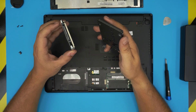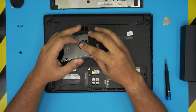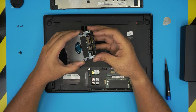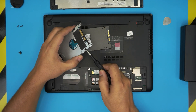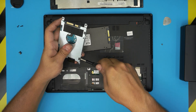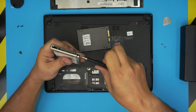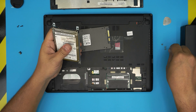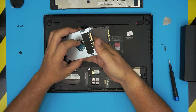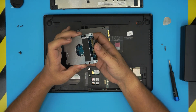I have an SSD here, but this one has a caddy, so let me remove the caddy. To swap the drives, remove two screws on each side of the caddy, take out the old hard drive, and put the new one in the same position. Remember, by upgrading the hard drive you will not have an operating system on the new drive. I made a video on how to create a Windows 10 USB boot drive — I'll leave the link in the description.